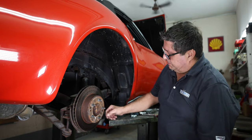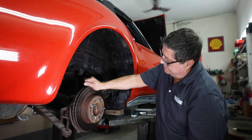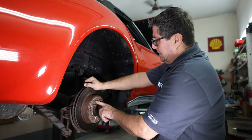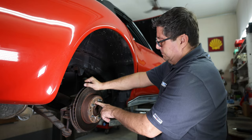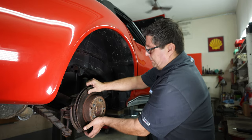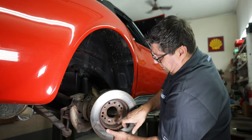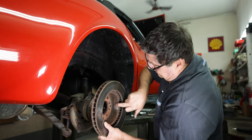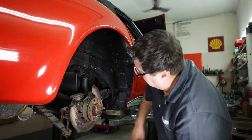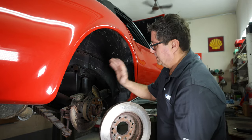The rotor has already been de-riveted. Somebody's done a brake job or spindle bearings once upon a time, so we don't have to de-rivet, which is kind of nice. If you do need to, I like to drive them out with an air hammer — some people will drill them out, whatever's good for you. These areas where the parking brake shoes ride have been replaced; they're stainless steel. We don't have to service those at this time, but we are putting new rotors and calipers on.